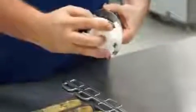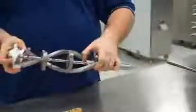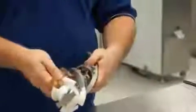To reassemble the beater, we'll first line up the notch in the end pusher with the notch on the beater body and slide it into place. We'll then slide the idler through the middle, making certain that it lines up with the hole in the rear. It should spin freely. To connect the scraper blades, we'll start the indention beneath the hooks and twist down.